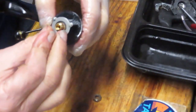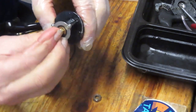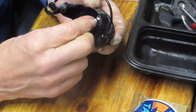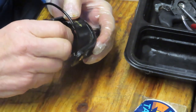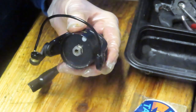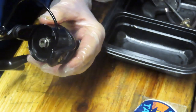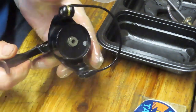Remember that little plastic collar that goes in here? We're going to put the rotor on, give it a spin, and make sure everything is working properly before we go too much further. You've got to put that plastic cap in there before you put the tie-down nut in — that tie-down nut is going to hold that cap. Just work that in and tighten it up by hand as best you can. Tighten it the rest of the way with an 11 millimeter.